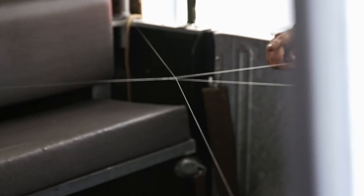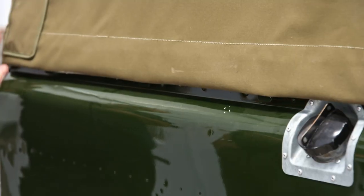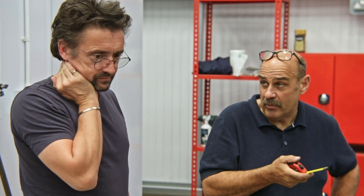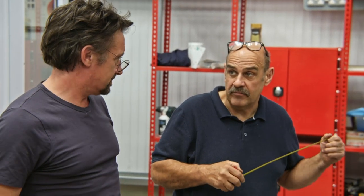Nothing is in the right place. You'll move one bit and it just chases all the way along the car. Net result is the doors don't shut. You can either shim the door to fit the car, which wouldn't be perfect but you'll make it work, or you'd want to disassemble it, reassemble it properly, and make all the bits of the jigsaw equal. But that's a huge difference — yeah, massive difference.